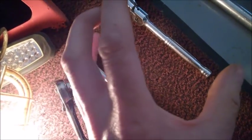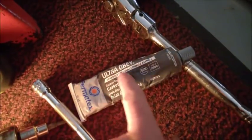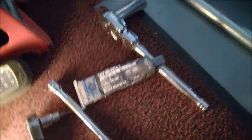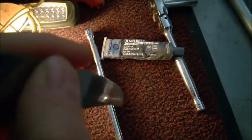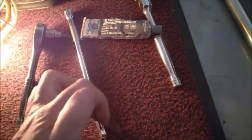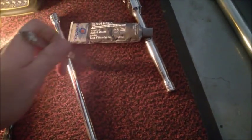The second difficulty is going to be, after you've removed the bolts, detaching the cover. That's because Volvo put, on some years, a very strong sealant, and the cover will feel like it doesn't want to detach no matter what. So you are going to need this. I use a thin butter knife. When you pry, try not to bend the cover, because you are going to have an issue sealing it back in place. So basically, I'm going to insert this at the very top edge, in several places, maybe tap it a little bit in there, and try to see when it starts to detach.